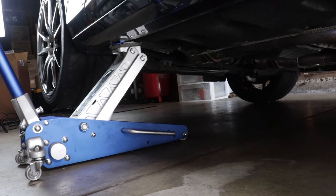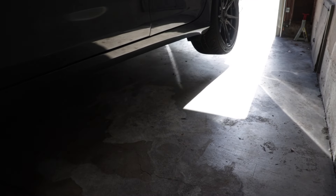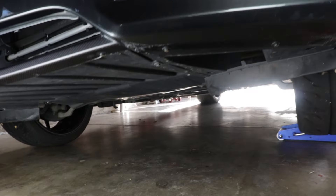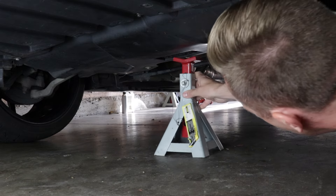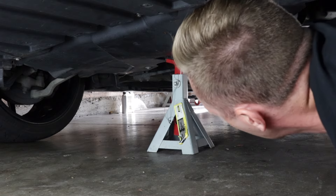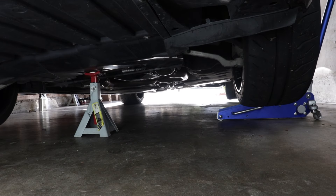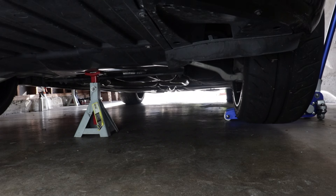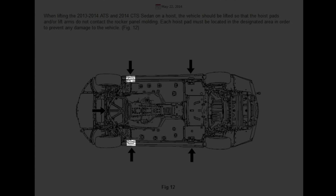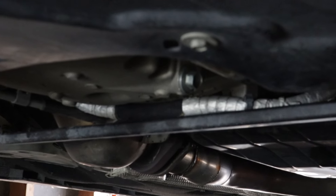Now we've got the car pretty well off the ground. The added bonus is that the rear wheel comes off the ground if you get it high enough — this is great for rotating tires if you don't have staggered wheels. There's plenty of room to get under the car. So what we're going to do is take a jack stand and put it under that other jacking point under the engine, get it lined up nicely, and then lower the vehicle on top of the jack stand and the car will balance right on that point. For more safety, put jack stands under the other forward pinch welds to keep the car from tipping left to right. Now if you're going to do an oil change, there's lots of room to put your oil drain pan under the oil drain bolt and the oil filter area.